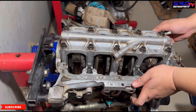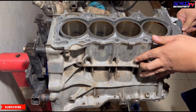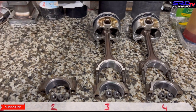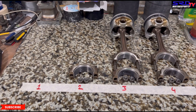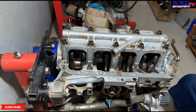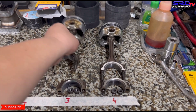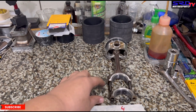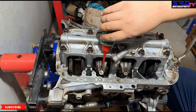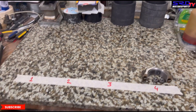Let's install the rest of the pistons. You can hear the piston rings. On to piston number two — let's grab it and the rod caps and bolts. We're going to time-lapse it because it takes too long. Oil the bolts. Now we get piston number three, and the rod caps. The ring compressor is quite easy when you're used to it — you don't need any special tools for that. Now the last one, number four, and then it's complete. It's an inline four.